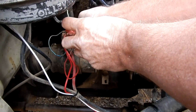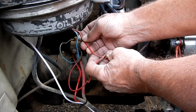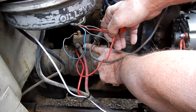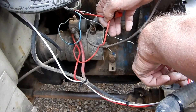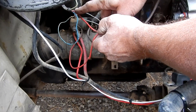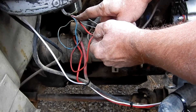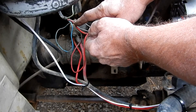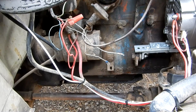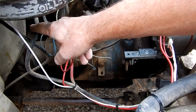The way it used to work is that this wire came off the voltage regulator and went down, came back up, and charged your battery through it with the generator. But now we're going to use this to draw power off the system to go over to the dash — it might run the lights or windshield wipers. There's also a wire that comes off the main positive battery cable that also supplies power to some of the electrical system.